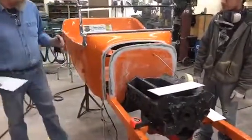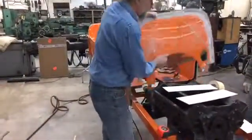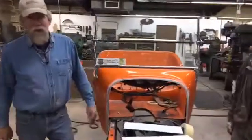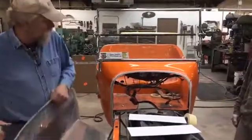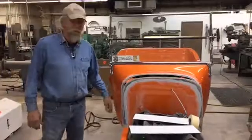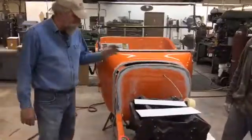We've cut this, we've moved it. If you've seen it before, we extended this frame 4 inches. I don't know if you can see in there, but it's been plug welded, it's been sleeved. If we were doing a live reality drama TV show, you would have got the drama yesterday. We had that sleeve so tight that sucker didn't just push together, so we had some conflict going on in multiple ways. We got that together, and instead of a 3/16 frame in that area, it's a 3/8 frame, and I can guarantee it's stronger where we put it together than it is in the other places, and it's pulling strong.